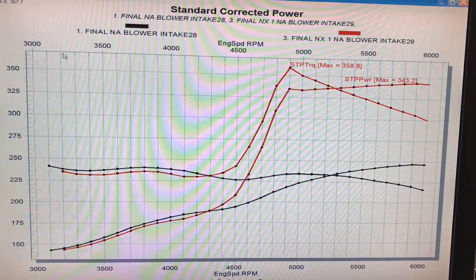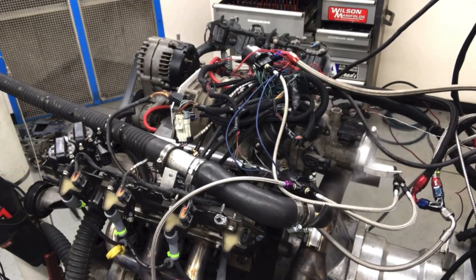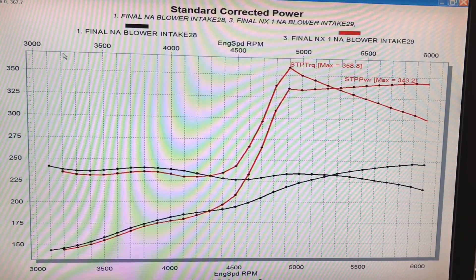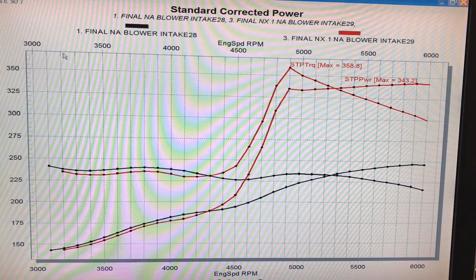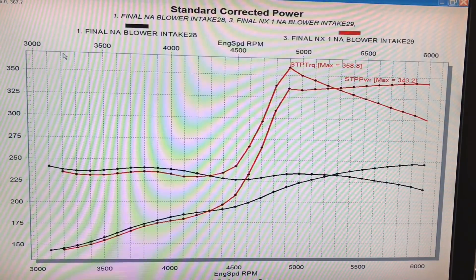Here's what happened when we added our first nitrous setup. I'm going to show you a quick video — this is the nitrous activation. I positioned the nitrous in front of the throttle body using a bracket, but unfortunately it was not aimed properly and was spraying nitrous all over the place. I wondered if that would affect power, so I made another bracket, redid the nitrous test — same shot, 52/28 — with the bottle heated using the West Tech bottle heater. Then we improved the aim and got all of the nitrous going into the motor properly.